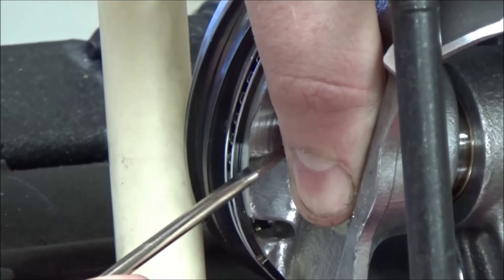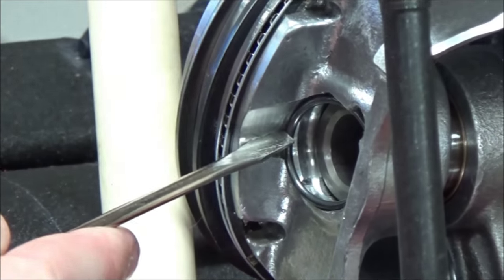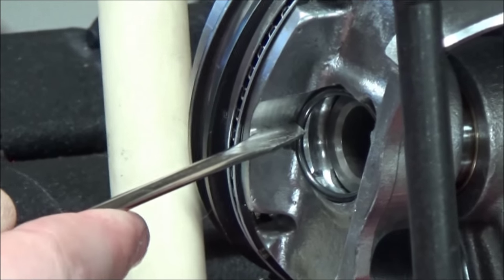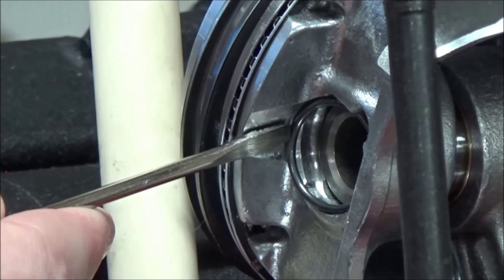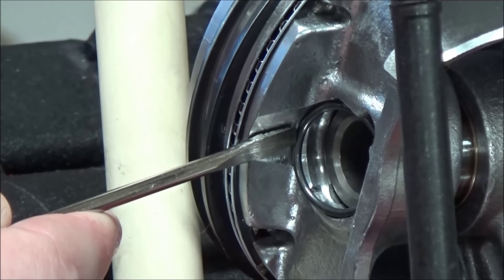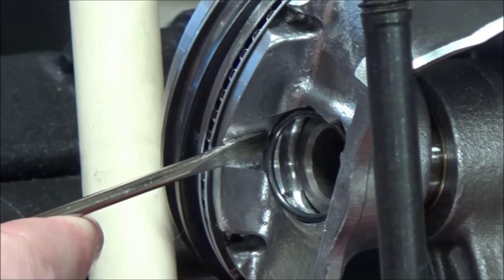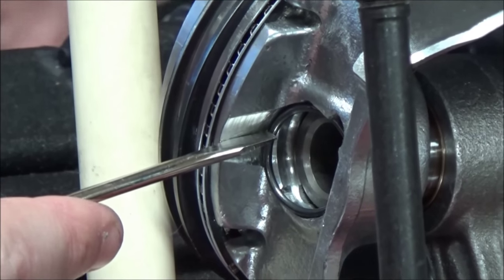Turn your screwdriver 90 degrees, move your thumb out for a second. Do you see how this is more real estate? Flip your screwdriver. See how that wants to walk off a round edge? Yeah. This is the difference in understanding the tool and realizing I'm flat on a round edge. Flip your screwdriver 90 degrees.